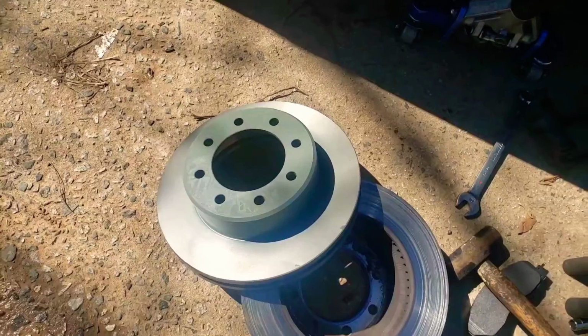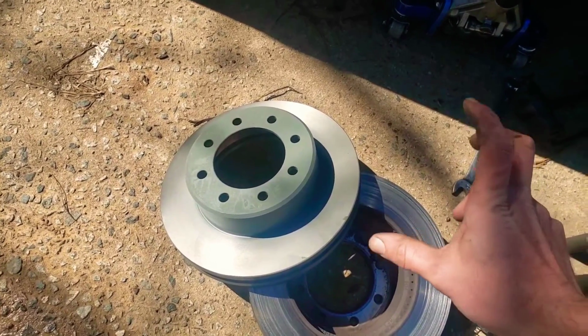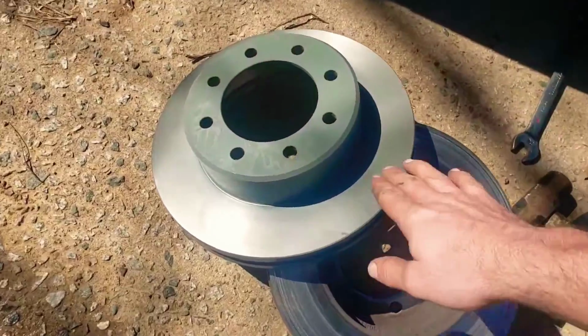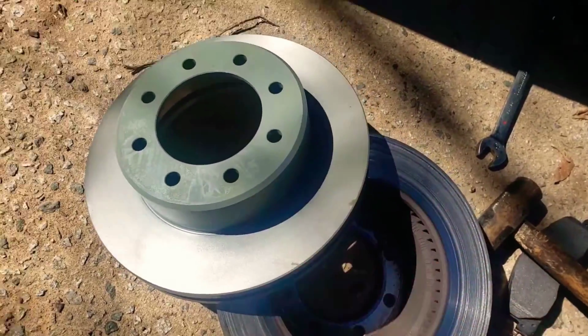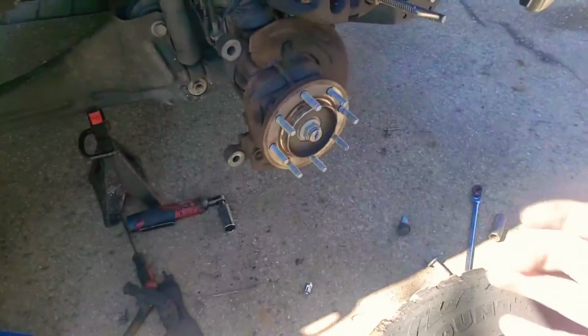Now, putting it back together, we're going to get our new rotor. Next, you're going to get you a can of brake cleaner. It's like an aerosol can, link below in the video description. Spray it down, take your rag, just kind of wipe it off. That'll get the grease that comes from the manufacturer so it doesn't get on your pads and all that jazz. Take your two hands, stick the rotor on there.